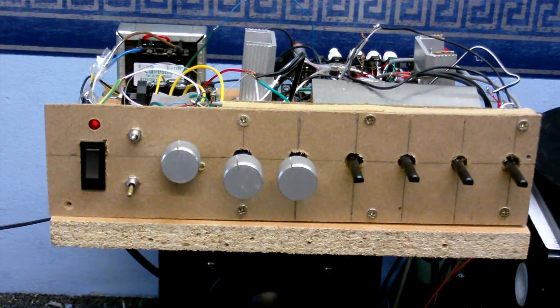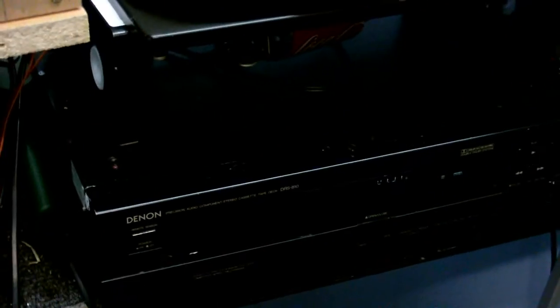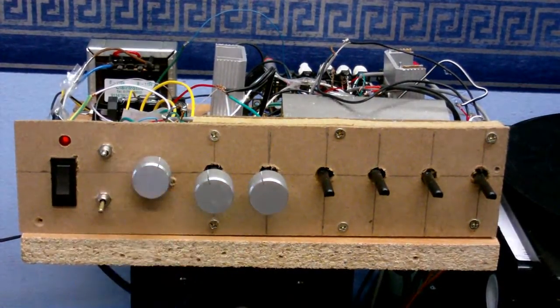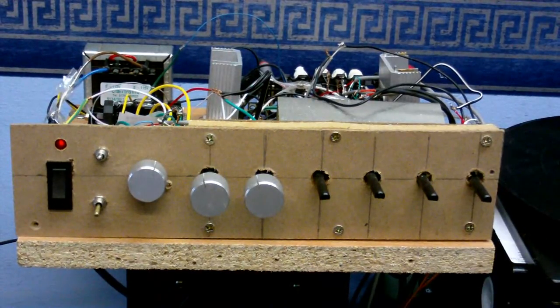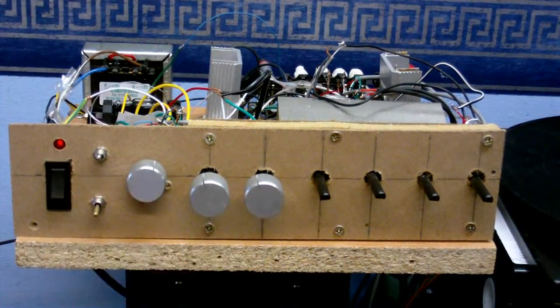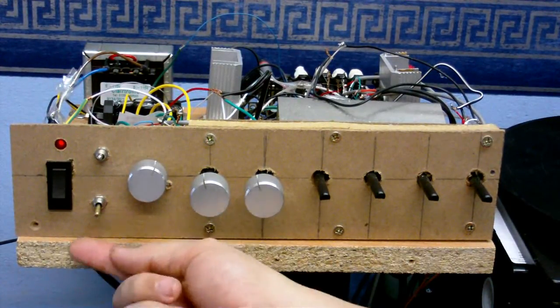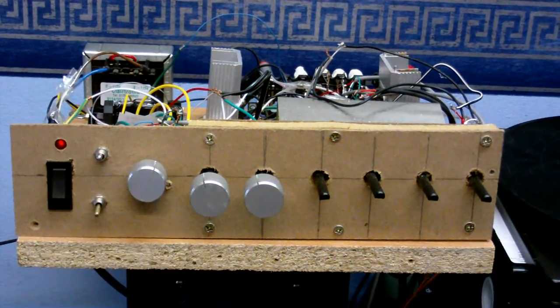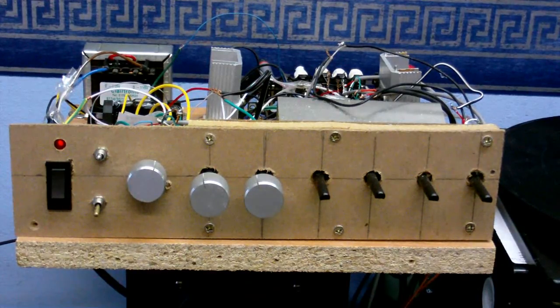So what if I wanted to record from one tape to the other? Let's say I wanted to copy that recording from the reel-to-reel onto the cassette. I would put this into tape dub mode. When this is in tape dub, it automatically goes into tape monitor mode as well, so the tape monitor switch doesn't do anything anymore. The tape select switch still acts the same as before. When it's this way it'll monitor from the cassette deck, and this way it'll monitor from the reel-to-reel. In tape dub mode it will connect the reel-to-reel's output to the cassette deck's input and monitor from the cassette deck, or vice versa.